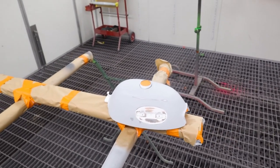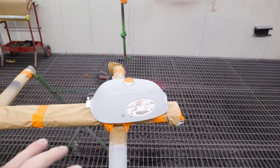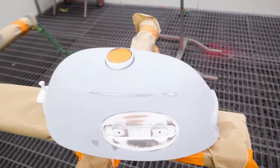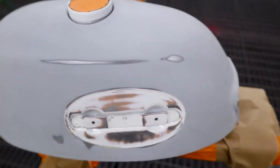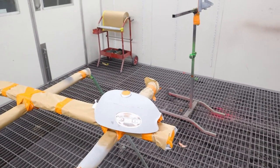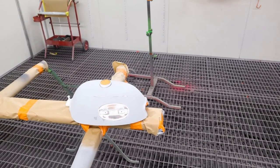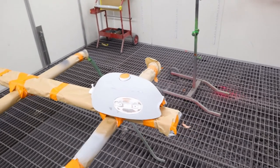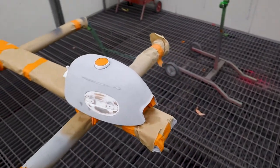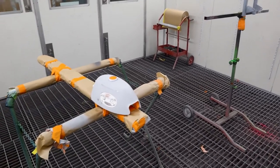Now, with that said, guys, I'll give you a quick rundown of the order that I'll be painting everything. Everything has been primed, as you can see here. On the tank, we do have a few little rub throughs down to bare steel, and a couple of little rub throughs here and there. So what I'm going to do, guys, is use the gray HS primer surfacer. I'm going to put one nice wet coat over everything. That will seal down all these bare metal areas and allow me to put my base coat colors straight over the top after roughly 10 to 15 minutes.